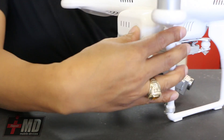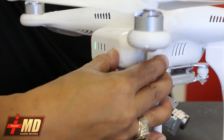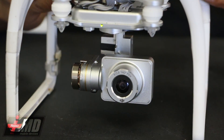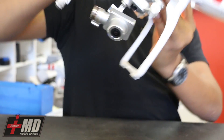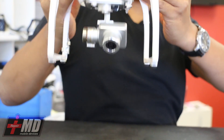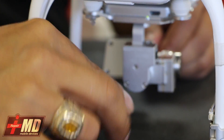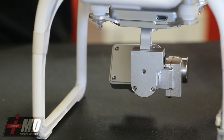We're going to go ahead and power on the drone now — press and hold for two seconds. Now let's take a look at the camera. As you can see, that completely fixed the problem. All you have to do after a crash, if it does shake around like you saw earlier, is just open back here and readjust the horizon for the camera. Then you have no shakiness.